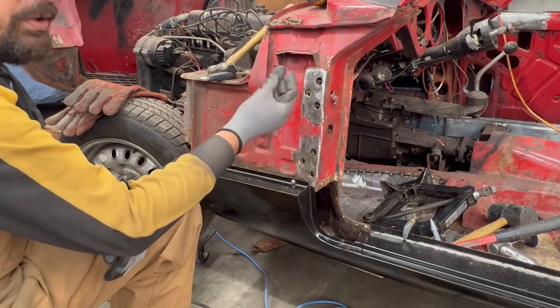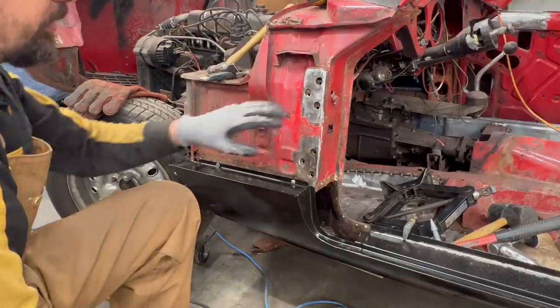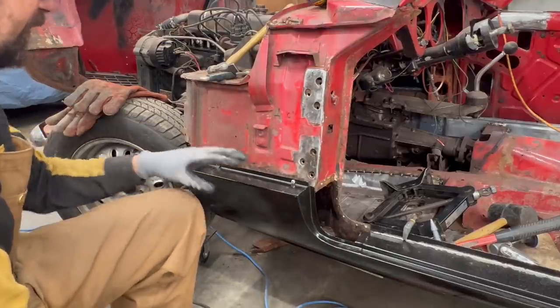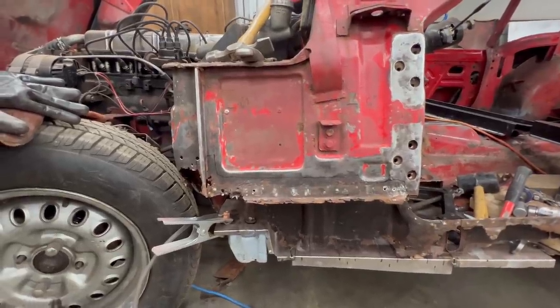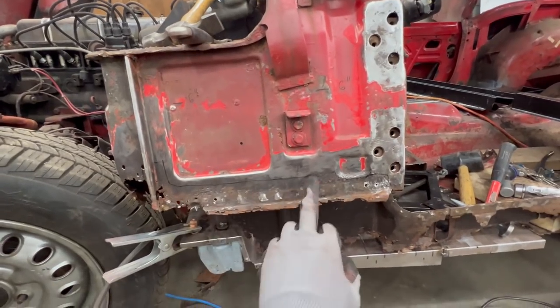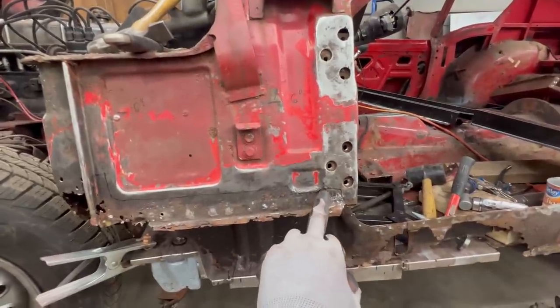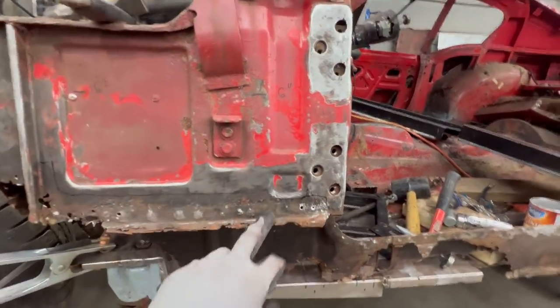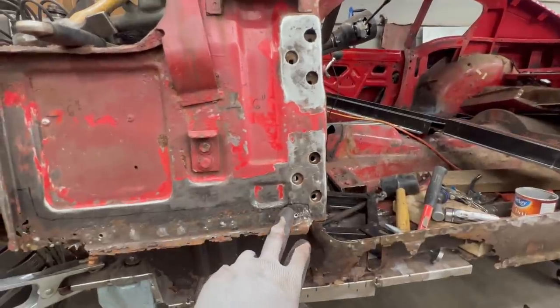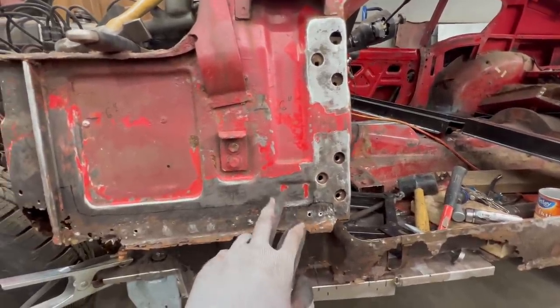Still my door needs to come out a little bit more. I know I can do a shim, but normally you could do that with the hinge as well. Anyways, we're going to get back there at some point, but now let's focus on this. That's where we stand. All this is pitted, so I'm going to go up to solid metal and only here I'm going to try to avoid disturbing this pressing — not that we can't make it, but we're going to waste too much time. So I'm going to cut it under it and we'll see.